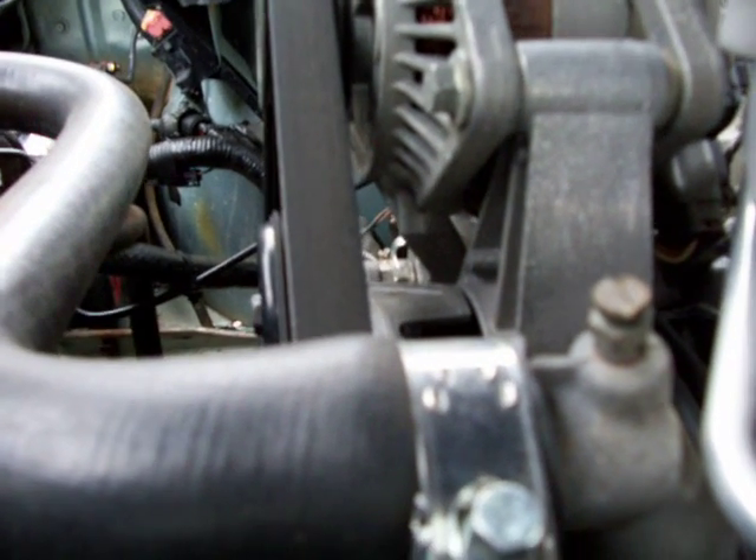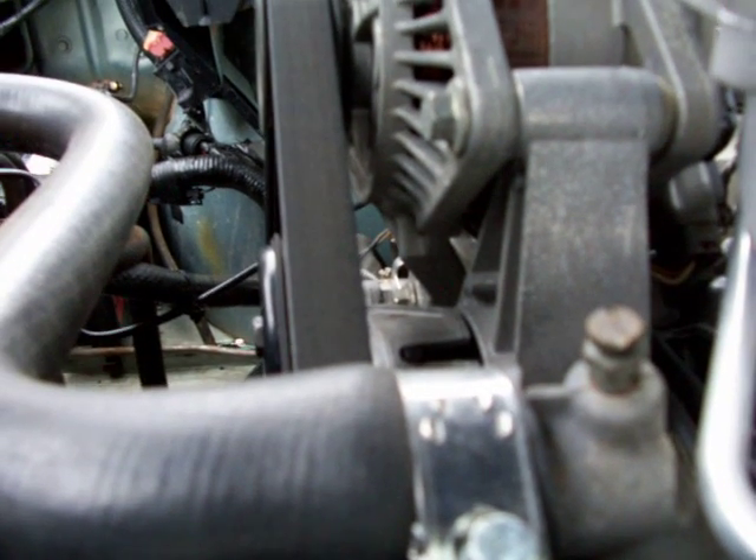I've started fitting T-clamps. They don't have a slot for a Phillips head screwdriver, so you just use a small socket. T-clamps are wonderful - they grip the hose effectively, tightly, and they have a really large clamping area. The large clamping area means it's less likely to damage the hose and more likely to seal. One of my opinions that isn't necessarily well-loved is that worm drive hose clamps are a piece of shit. Using a flat blade screwdriver, the screwdriver is always going to slip out. They don't look professional. For an extra $2, you get these really nice T-bolt hose clamps. These came from an irrigation shop - they are Norma brand, and I highly recommend getting them. They're ten times the clamp of what they came with.